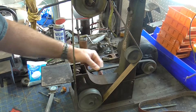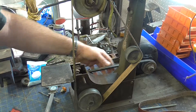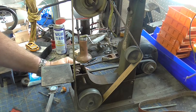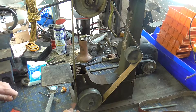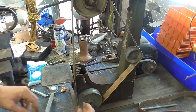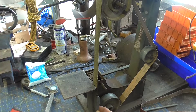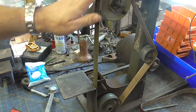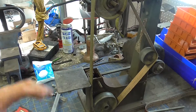So we go ahead and mark off the counter marks. I've got one revolution at 11 inches, 22 inches, 33. And we've gone past it a little bit, but I'm going to take a mark here — I know I'm at 44 inches there. I back it off just a little bit and I see that I've got about an inch and a half or so of room between that mark and that mark. So I can ballpark that this belt is about 43 inches long.